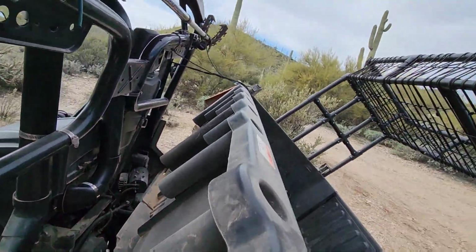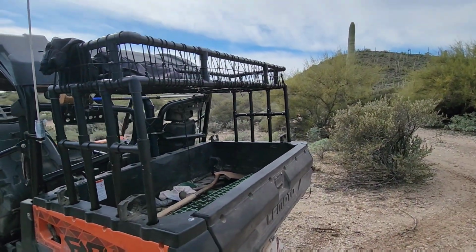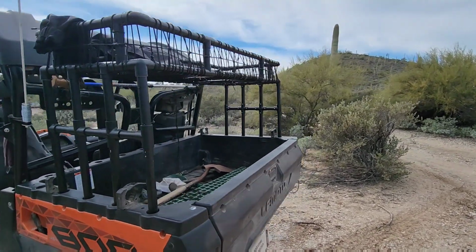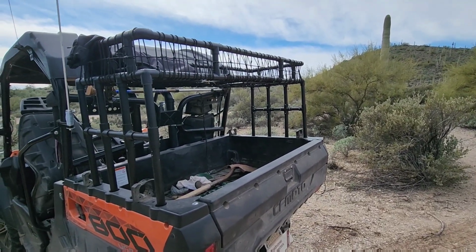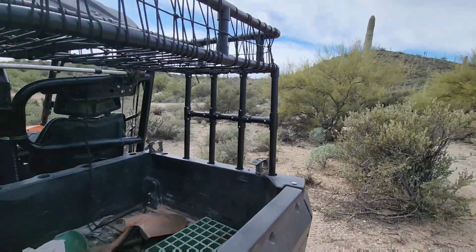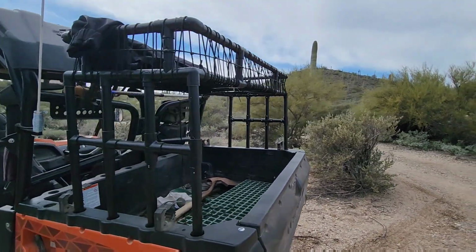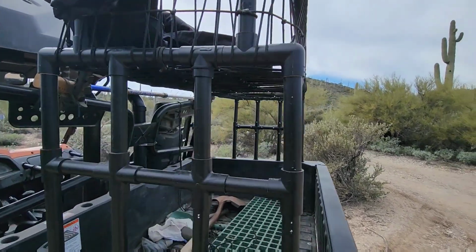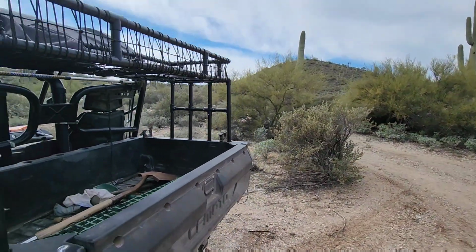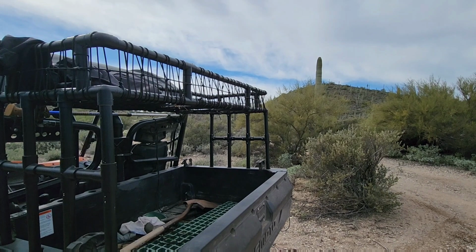The only other thing I'll share with you today is I wanted a rack for the bed, and I made one. I wanted to make it light, so basically all these parts here are PVC, and it's been painted. Now, I wouldn't do this again, and I don't recommend it. You can see a bunch of these screws in here. Glue joints were failing. It was falling apart all the time. It's not very durable, and I didn't save any money to speak of because, frankly, it cost a lot of money. These parts here are very expensive, and you wouldn't believe it, but it actually took the better part of 30 feet of 3/4 inch PVC pipe, plus all the fittings.